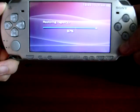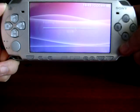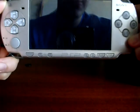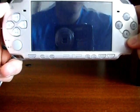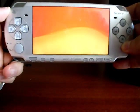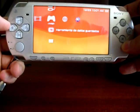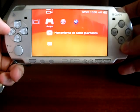I've already forwarded the video. Now you have to press X to reboot or cycle to shut down. I press X so it will reboot. You can see the PSP reboots with the Pandora battery because my Magic Memory Stick was made with Time Machine. If you don't make it with Time Machine, you have to put a normal battery to boot your PSP after the process.